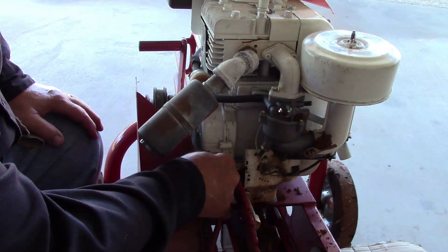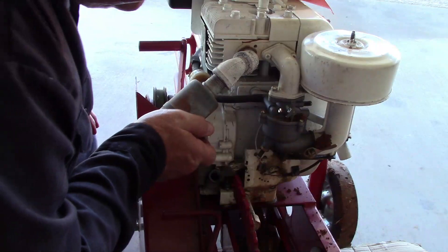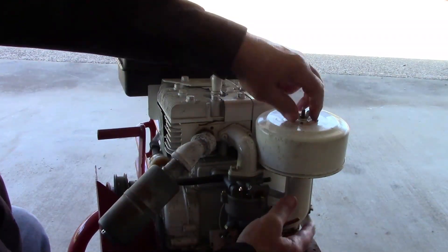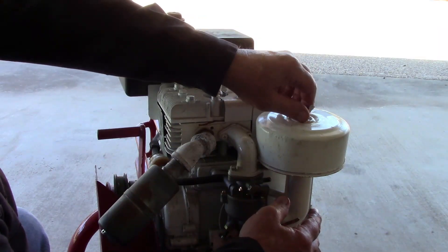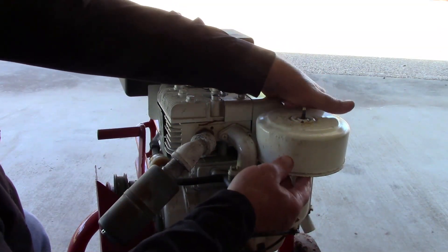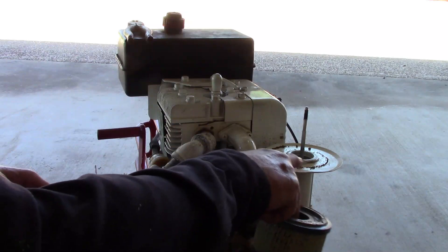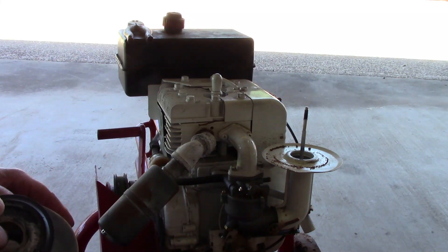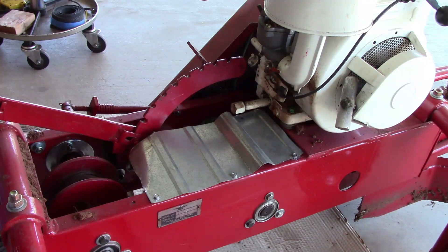The first thing I'm gonna do is check the oil level. I can tell it's down a little bit, so I'm gonna top that off. We'll check the air cleaner — it was new when I put it on there sometime last year. It still looks good, but it does kick a lot of dirt up there, so I'm glad I got this out and I'll clean all that off.